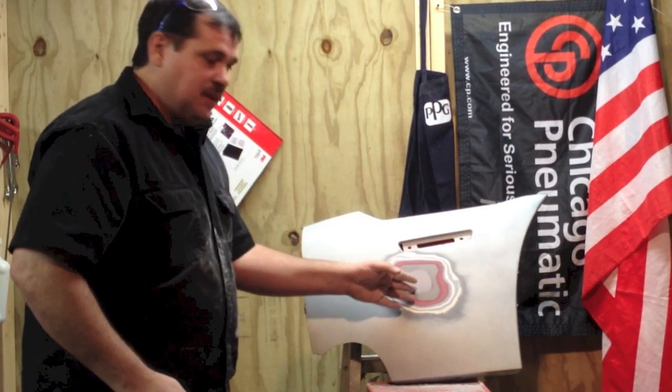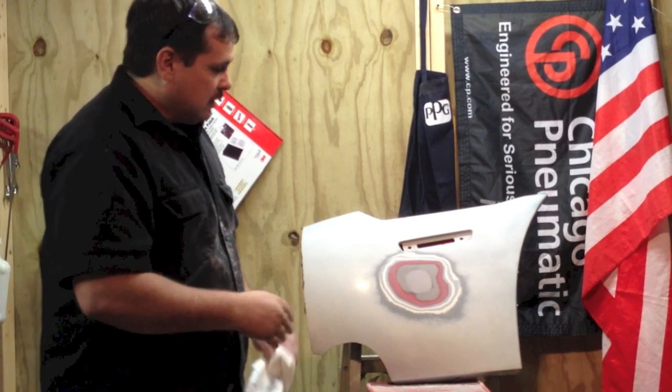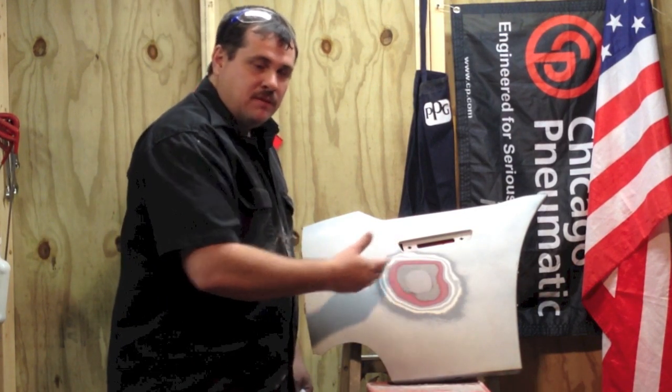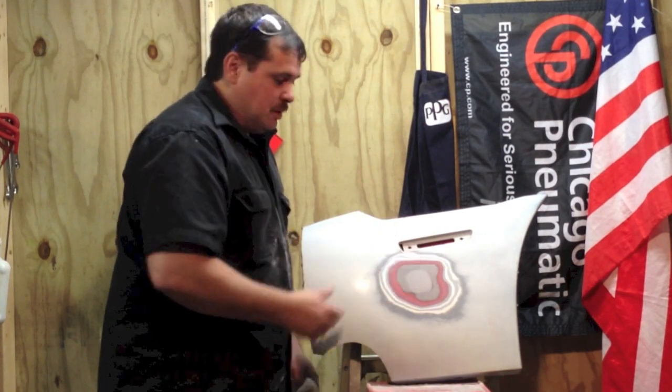If there's still a low in there after you blocked it out, you may have to apply more. But remember, if it's bare plastic, you know you need to put the adhesion promoter back on, allow it to dry for 5 minutes, and then put another coat on and re-block it out.